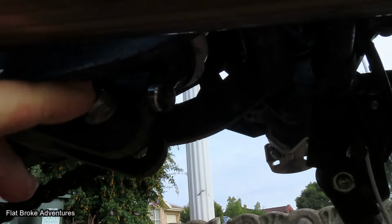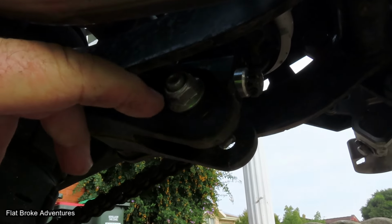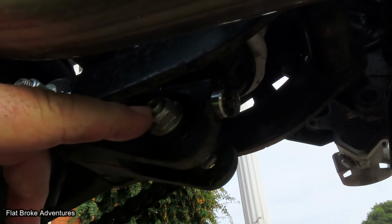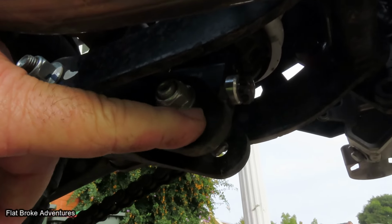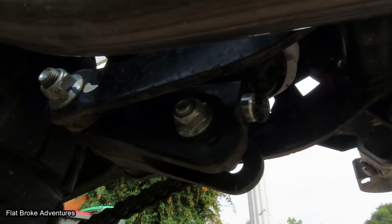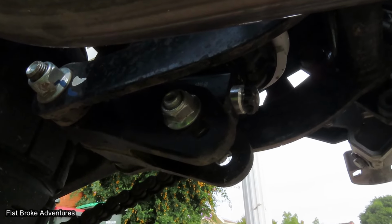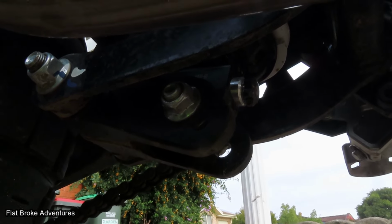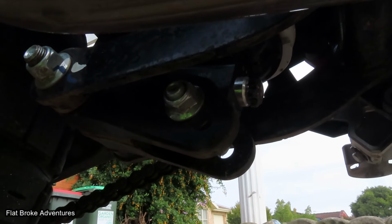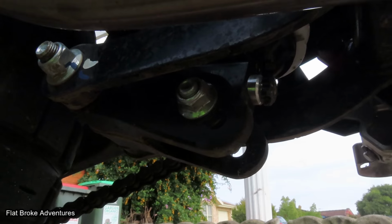Now you can see, let's target the camera focus, the lower bolt on the rear shock. That mounting bolt needs to move from there to there into that hole, and that's it. That lowers the seat height 20 mil, which will be a great help for me being a bit shorter. So yeah, stick around, watch what I do, and see how we go.